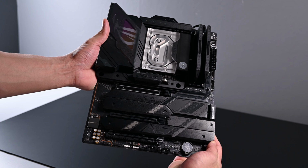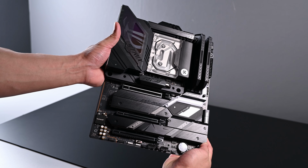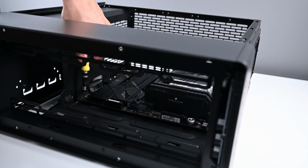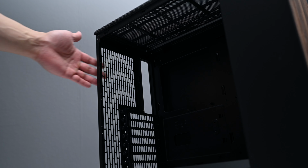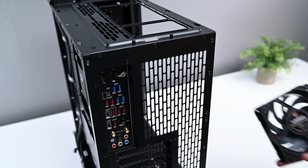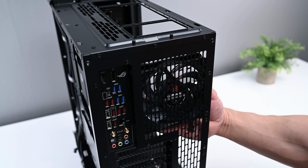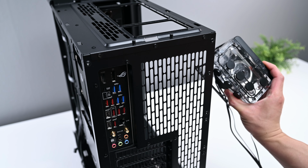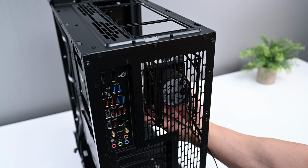And as for the motherboard, I've already prepared it in advance, which is a process most of you have probably already seen many times before, with installing the CPU, SSD, RAM sticks, and CPU water blocks, so we'll go right into installing it into the case. The neat thing about the rear panel of the North case is that the ventilation cutouts are spaced just right where you have the option to easily mount a common 120mm fan or pump res, like the Uni 80 here that measures 105mm by 65mm on the mounting dimensions, without any modifications.